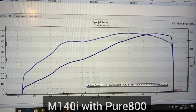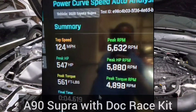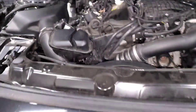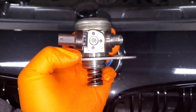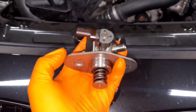Shout-out to Peter Pure for sharing data — they made 580 wheel horsepower with a Pure 800 turbo on an E30 mix. Also, Twisted Tuning — thanks to Justin — ran 93 octane on a Mustang Dyno, which is probably over 600 wheel horsepower on a DynoJet. The reason for the difference: with this mechanical fuel pump, pressure is created by the exhaust cam pushing the actuator up and down. So at 2,000 RPM you have half as much fuel capacity as at 4,000 RPM, and at 6,000 RPM you have twice as much fuel capacity as at 3,000 RPM.